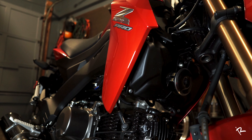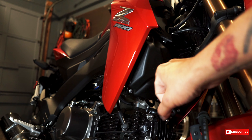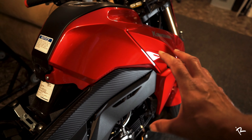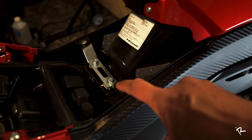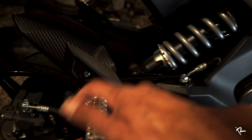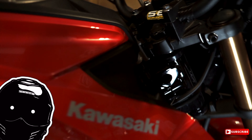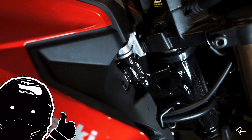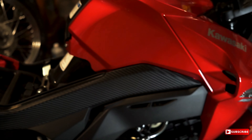The goal is to let the bike breathe a little bit more. The first step is I believe I'm going to have to either loosen or remove this side panel to be able to get that box off. To get this entire side panel off, you want to loosen and remove the screw here, this screw, and the screw right here by the passenger peg, and then this whole thing will come loose. You also have to push in this little push pin that's located right there.